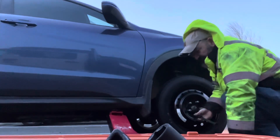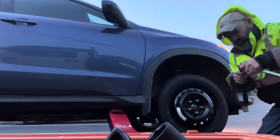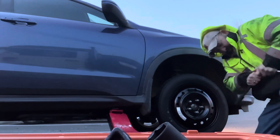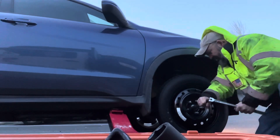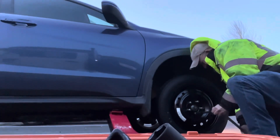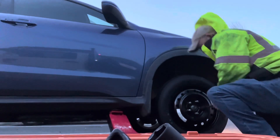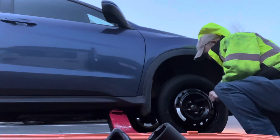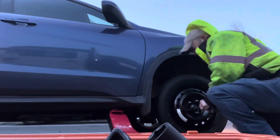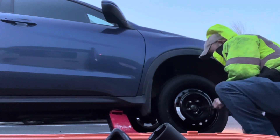The bolts are on. We're going to lower the tire down here shortly, but first we're going to tighten one or two of the bolts and then torque the bolts to the right spec — 60 to 70 foot-pounds — to make sure it stays on there. This whole process is usually about 10 to 15 minutes, and the customer's on their way after that.